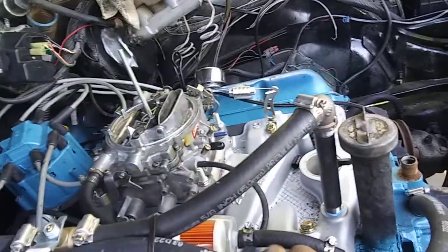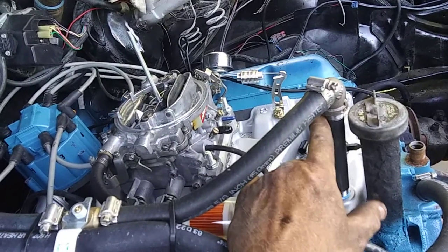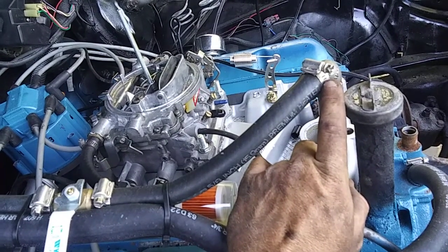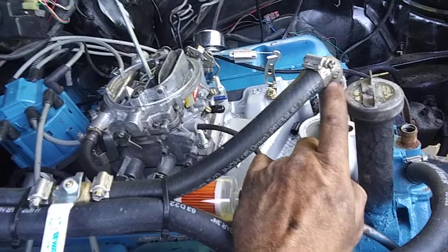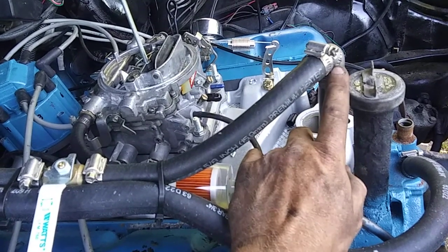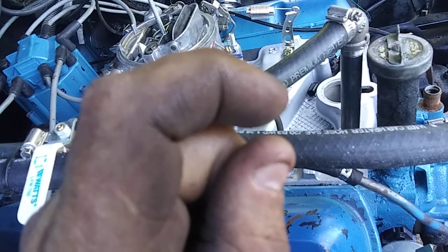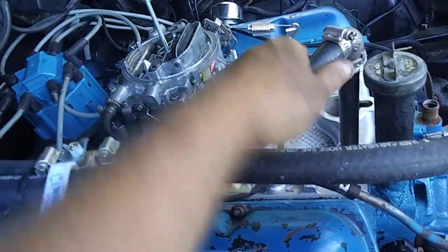Here's some custom work I like to do: this is just a six-and-a-half inch black pipe fitting. I ran half-inch into a half-inch fitting down to roughly five-eighths. The problem was the threading on the fitting was too big — a five-eighths inner diameter hose wouldn't fit over it. So I ground off all the threads, left enough material so it won't crack, and got enough surface to slide the hose up on and clamp it.